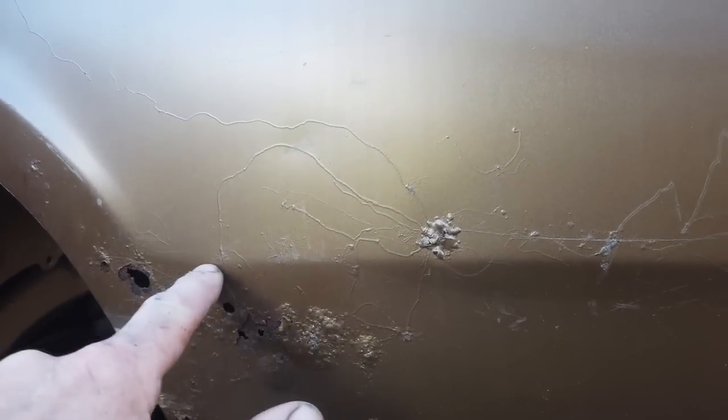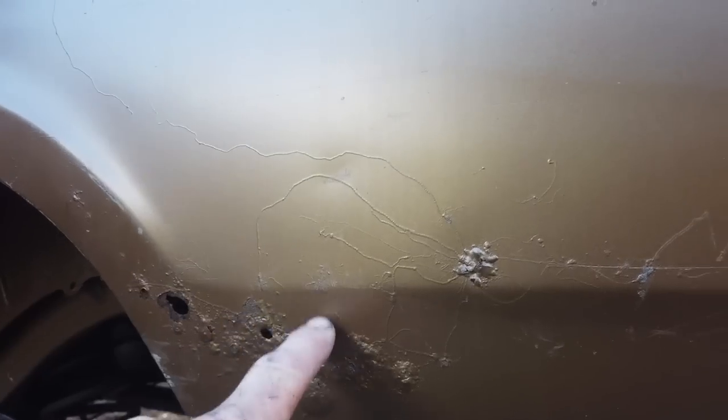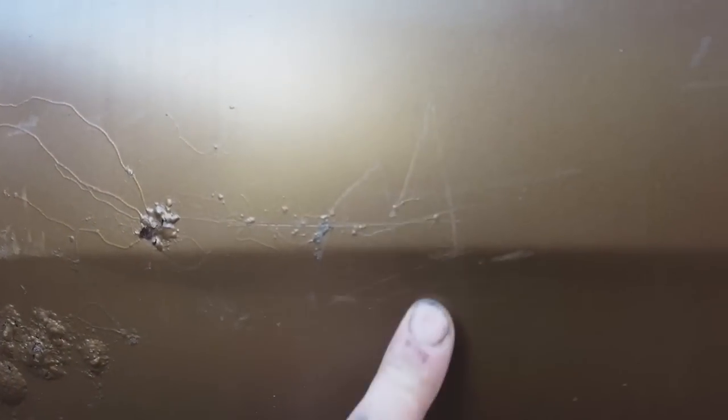So we'll be cutting. Well, I don't really want to cut on the swage line. I'm going to have to cut below it. This is going to have a patch. We need to cut below. We're going to hope there's no more rot above that line. I want to be cutting under that. You don't want to lose that for sure. That's definitely needed. So I'm going to go below it and scoop in when they arrive.